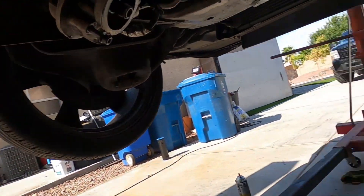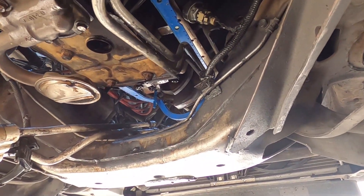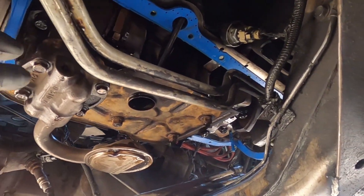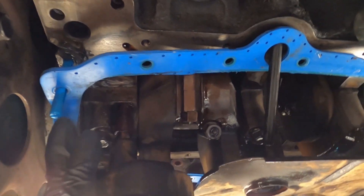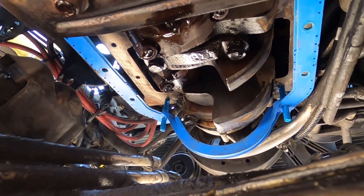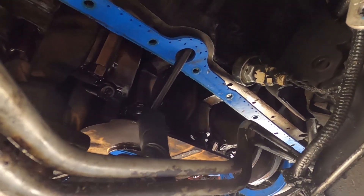All right everybody, this is the next day. We had to quit — it got super hot, it's been like 115 degrees here. It is the next day and I actually got everything kind of prepped up. I got the gasket kind of lined up as well — this is a Felpro gasket kit. They give you these really cool guide pins. You put those on four corners of the engine and it helps keep the gasket in place so you can get the oil pan nice and seated correctly with the gasket lined up.